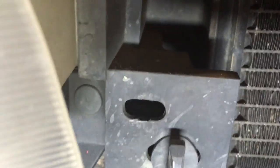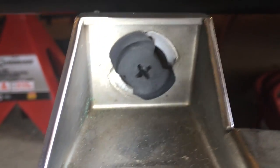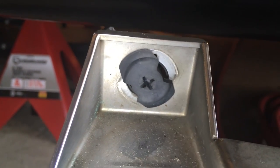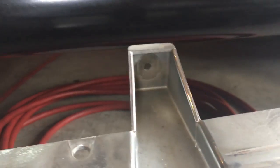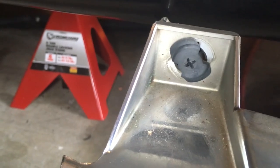There's one here, one there, one there, and one there. Essentially what you do is use a Phillips screwdriver — you can see the clean areas, that's where it is in a normal situation. You just turn it at a 45 degree angle. There's the grille, and that's where the 10 millimeter bolt is. That's the first of the 45 degree angle clips.